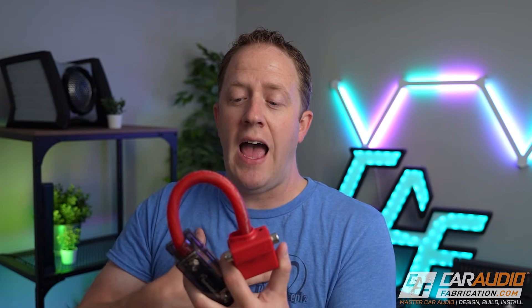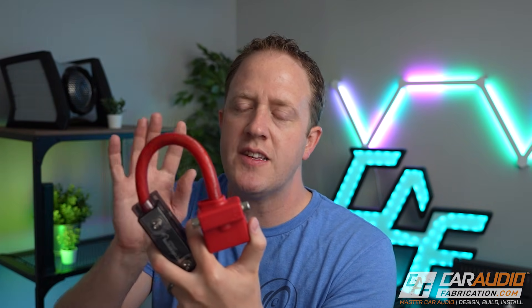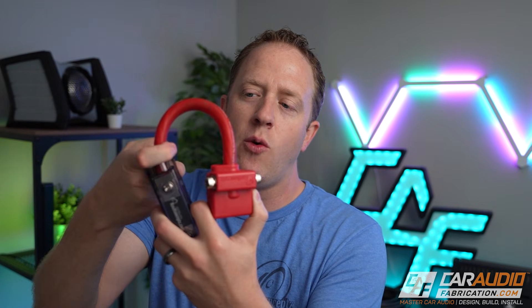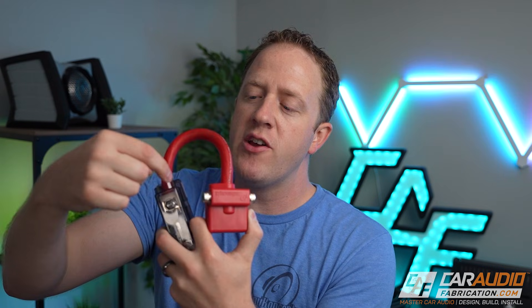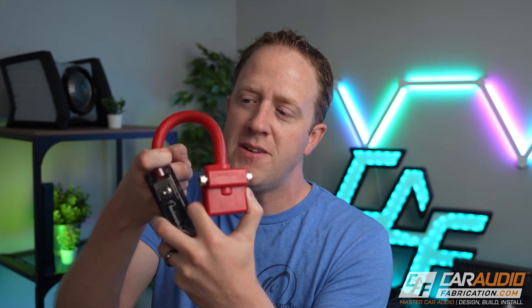It can loosen that screw over time, so you want your inline fuse to be robustly and securely mounted. Another huge installation consideration is to do some sort of secondary mounting of this wired connection. I like to add zip ties to this wire to secure it in place, so that if this connection were to ever come loose, there's no way this wire can pop out and rotate and potentially touch the vehicle ground. When fabricating a custom bracket to hold your inline fuse, you can add a couple of holes in that bracket to run a zip tie around this part of the wire and clamp it in place — so you're not only relying upon the inline fuse screw to hold the wire.